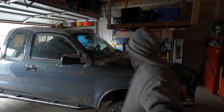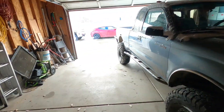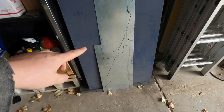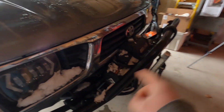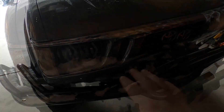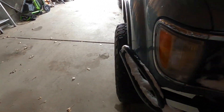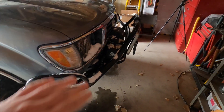Unfortunately it snowed last night, but we are back working on the front bumper. I got the metal all traced out from my cardboard template, and now I got to cut that out. After I cut it out, I'll slowly keep fitting it on, and I'm going to tack it on. After it's all tacked up good and strong, take the bumper off, pull the truck out, weld it up nice and good, get it all cleaned up and ready for paint, and hopefully paint it tonight or tomorrow night.